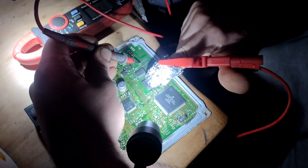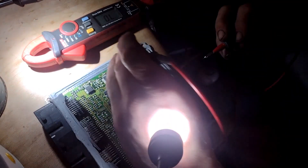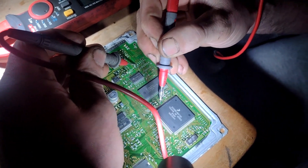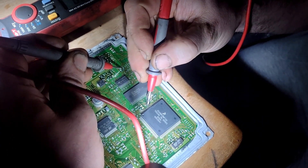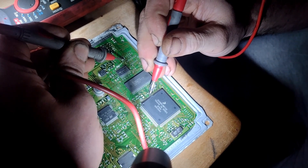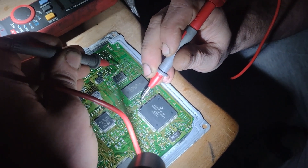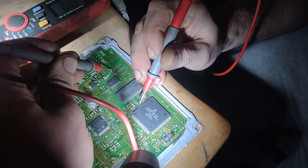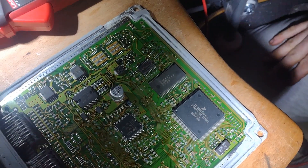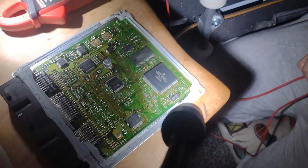You can go down the board like that, and when you get it closer just change it out again the same as before. This is how I figured out that these were the 14th and 16th pins along the connector. Then we move to the next one, which was a couple over. That's one of them, there's the other one, and that's that track right there. That's one way I found useful - if you've got no idea where the wires go it certainly makes it quicker using something like this, and it's cheap and easy.